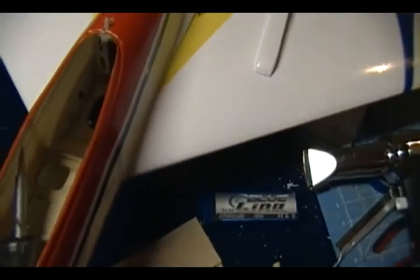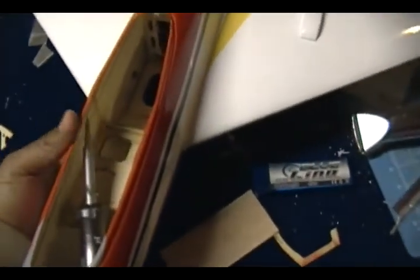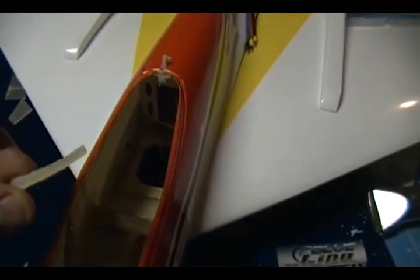I was taking this frame off — as you notice I already started on it. I figured I'd try the heat gun to see if the glue will soften, and it actually does. You have to be careful though because you don't want to hit it too much or you're going to mess up your fiberglass. I hit this point right here and the glue just peeled right off like caulking. When it dries again it's hard, but it just softens the joints.